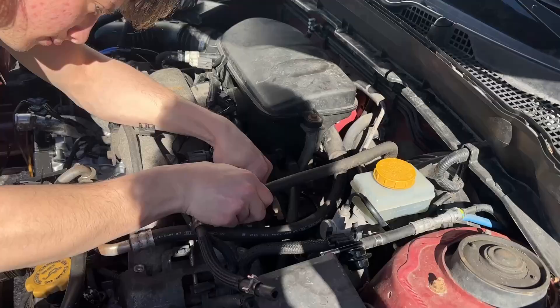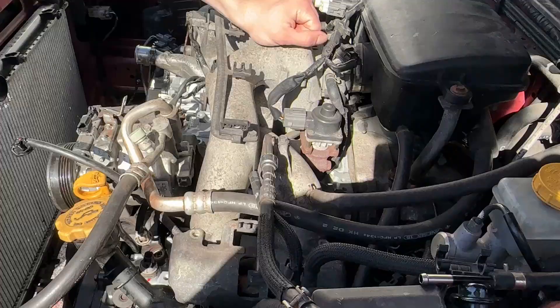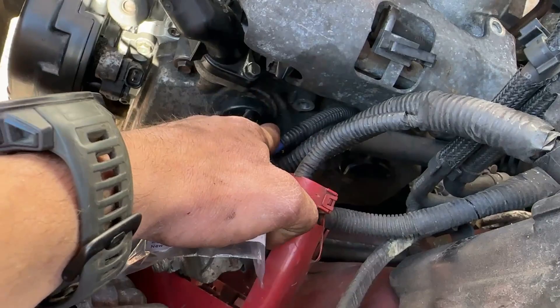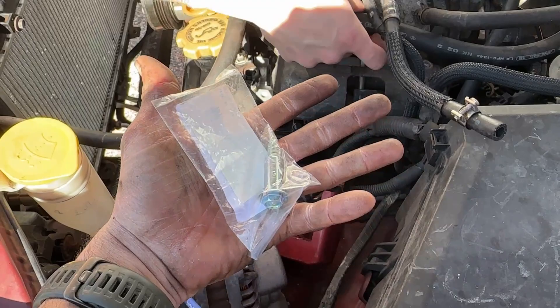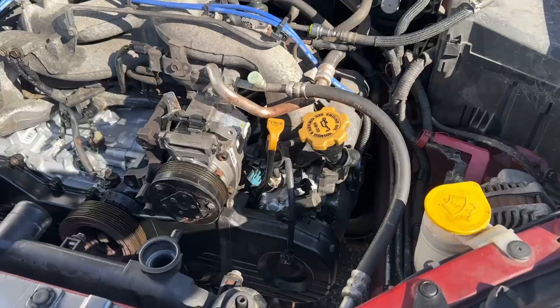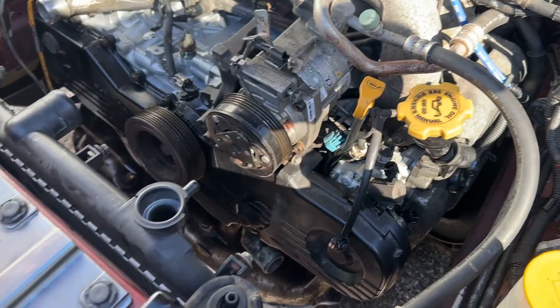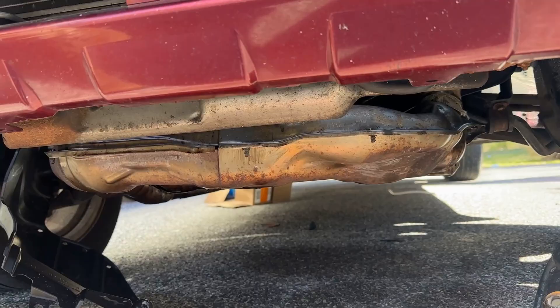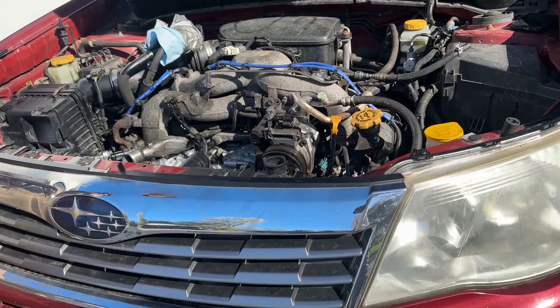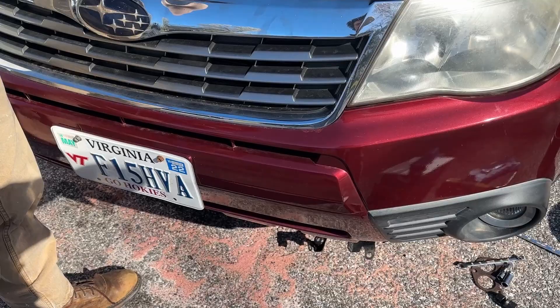Tyler's here now. We're starting to get some hoses connected. I also forgot to mention — I left that valve cover bolt undone. I got new ones here for $7 each — 12 millimeter, should fasten and hold the gasket nice and tight. Spark plug wires are run again. Tyler's throwing on the front radiator supports while I get underneath for the exhaust. The exhaust cross piece is secured with two bolts on each side. Getting engine mounts in — 14mm bolt on each side — and then the underside work for the engine should be good.